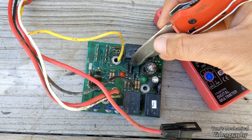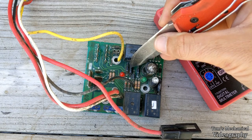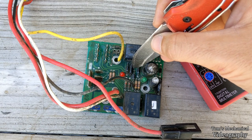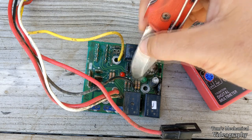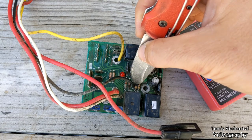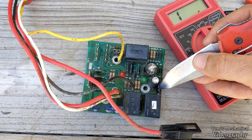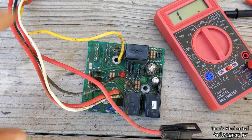This over here is a 3.3 ohm carbon composition resistor, half watt. As far as I can tell, might be a watt, but I'm pretty sure it's a half watt based off of the dimensions. It's 3.2 millimeters in diameter, and I think 9.2 in length. And I think these guys are a little bit longer than these thin film resistors. So I think this is the same half watt size as this guy. This guy is also a half watt carbon composition resistor. This is a 33 ohm resistor. Both of these are 5% tolerance.